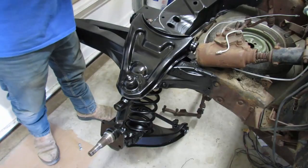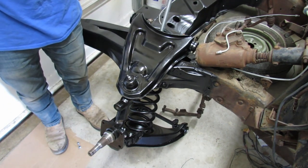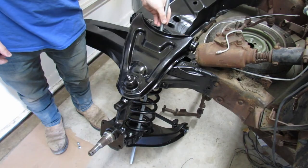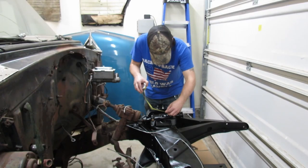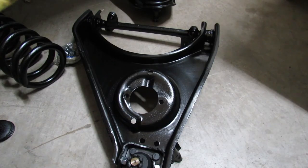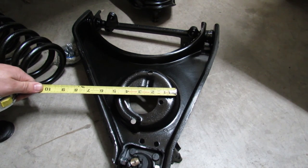And speaking of homemade tools, we gotta fab one up real quick. We're gonna use this 1/4-inch plate, 5/8 ready rod, and a couple 5/8 steel couplers. It's gonna go something like this. Measure for our top plate, because we're going to have a top plate and a bottom plate we're going to make out of that 1/4-inch. Okay, we'll go about 2 inches. Take advantage of the passenger side lower control arm, not on the car yet. And yeah, let's just go with 5.